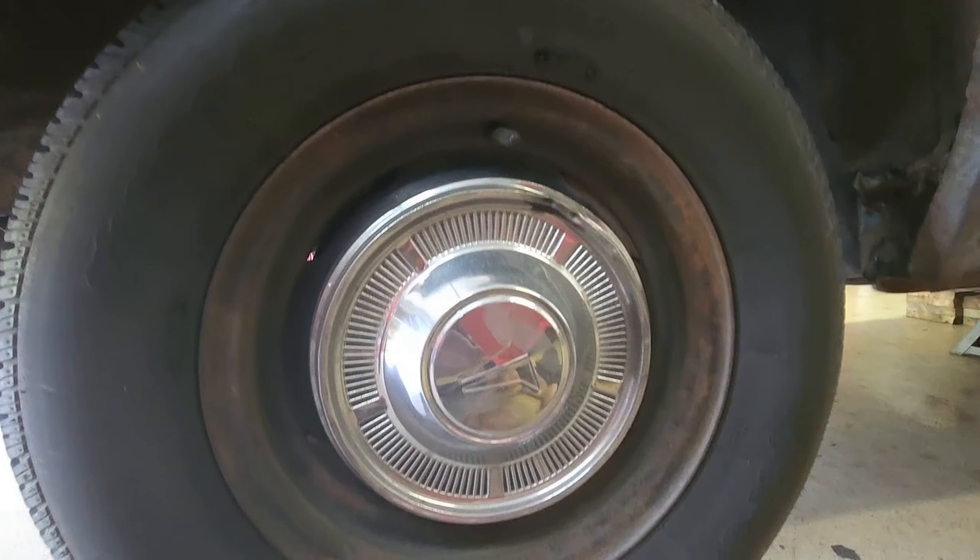What I'm going to attempt to do is put a tire underneath this thing without modifying the inner wheel tub. You can see this is the unibody frame rail — I've got about an inch or so I could cut. Like on a Trans Am, Firebird, or Camaro from the '70s, you can split it in half and potentially gain two inches of wheel well. But the question is what effect that would have on the rear seats, because I do want to continue with a stock-style interior.